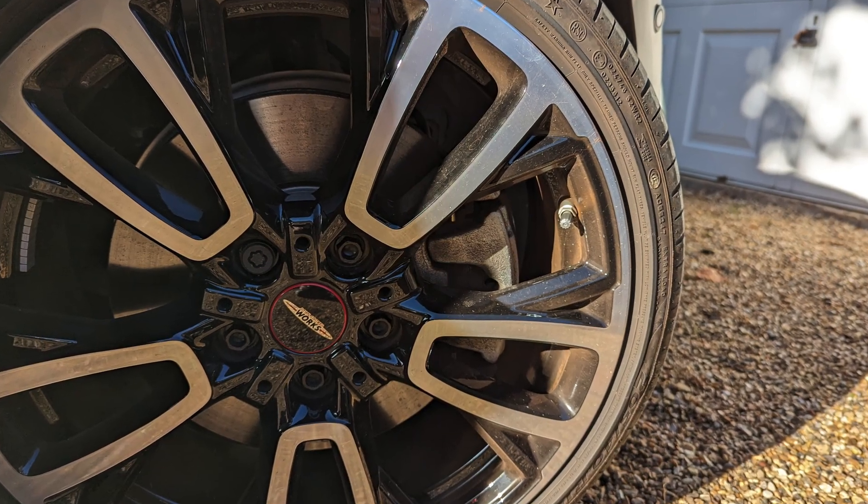The claying's all done. Now giving it a rinse off and a final dry before I take it inside. I'll start with the big towel — that is the Hydro Hoover XXL from Details United, available on Amazon with a link below. Then I'm going and blowing out all the tight gaps to get rid of all the trapped water, using probably my least favourite drying towel, the Rag Company Liquidator — really ineffective, but it's the smallest one I've got and it's great as a catcher for drips running out. You don't want to blow water around the panel making more mess — best to blow it into a cloth and dry it straight away. I'm showing all the different places I tend to use the pet dryer for the car, all the places where you typically get the most trapped water. You want to get that trapped water out before you start polishing, because the vibration from the polisher will make it drip down and dilute your polish.